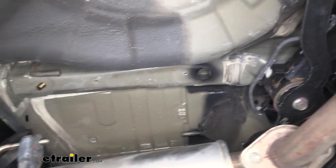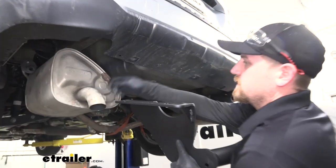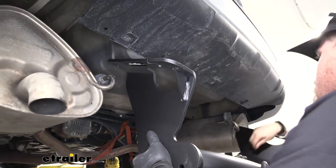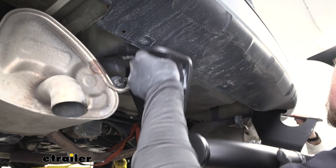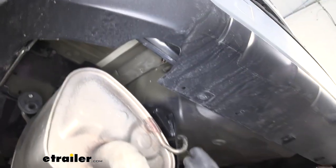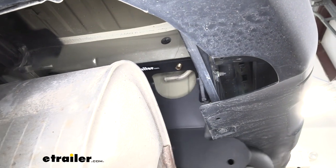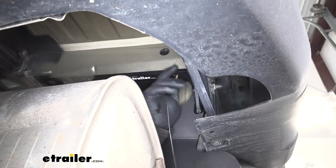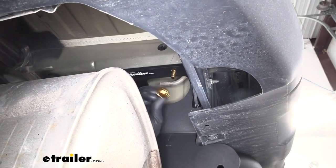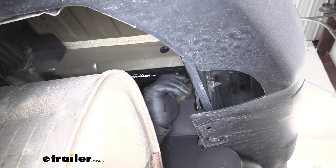Pull the other end of our fish wire and get it to drop out. Now with an extra set of hands, we're going to raise our hitch into position, take our fish wire and put it through the corresponding hole in our hitch, going up and over our exhaust, then lift it up and get our carriage bolt to drop through. Pull that fish wire off, then take a flange nut and get each side started hand tight so the hitch will support itself.